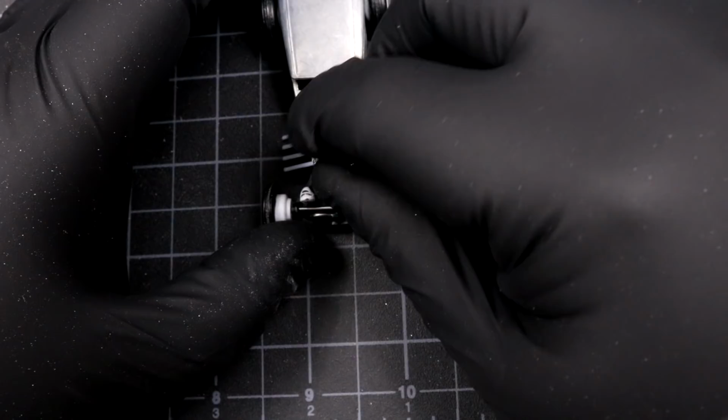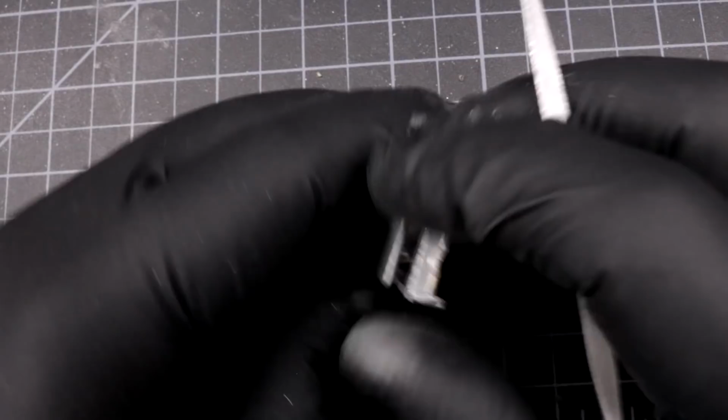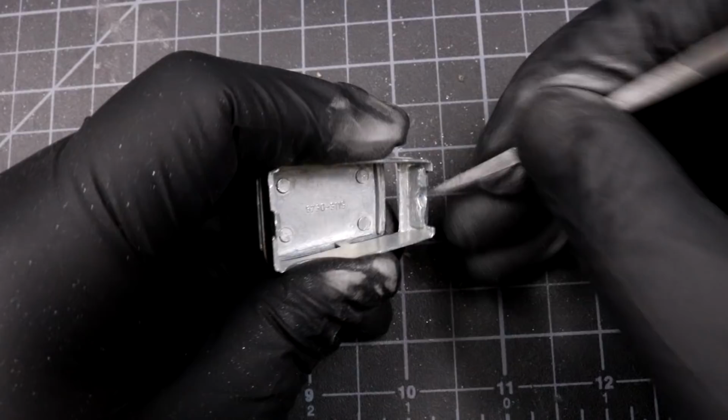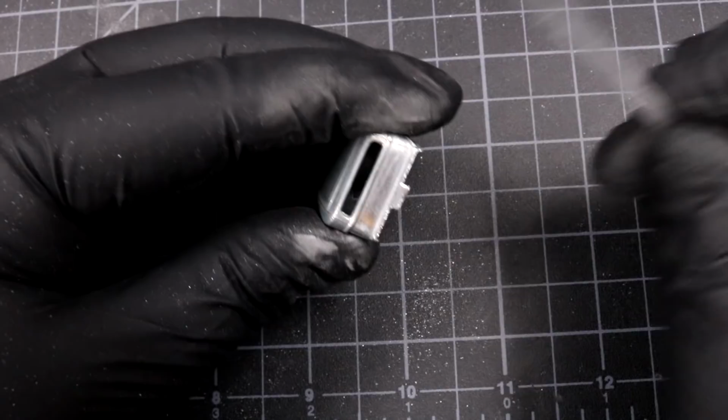That'll be pimp. We're going to be way cooler than this thing. I'm just going to carve it up really good in there with my files, so we got a nice surface for our putty to bite on. We'll do the same over here in the front. Let's really scuff it up good. Okay, I've got everything prepped for putty. One step that we should do, whenever you're using putty, you got to make sure that this stuff is degreased and super clean. So for maximum bond, I'm going to wipe this down with a little bit of alcohol. We'll come back and we'll put some putty on here.